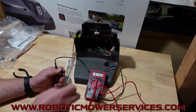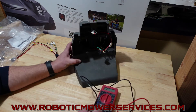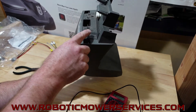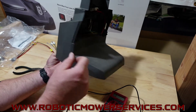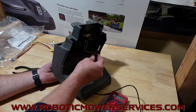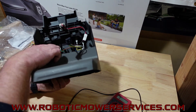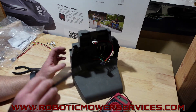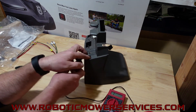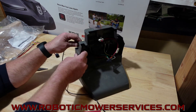Now, on your housing — your tower — what I like to do is leave the wire connected, because inside here you can disconnect them. I like to leave the wire connected to the terminal where you connect your boundary wire and your guide wires, and measure from here all the way through, because that way I'm killing two birds with one stone. If I can test from here through this plug and everything's good, that means I don't have an issue with corrosion or oxidation stopping power. All you've got to do is take one probe and stick it here on the terminal on the outside — just push it right into the hole on that male spade terminal.